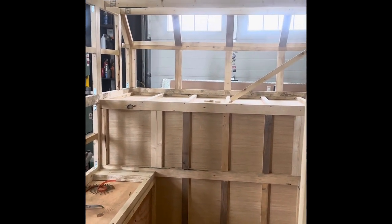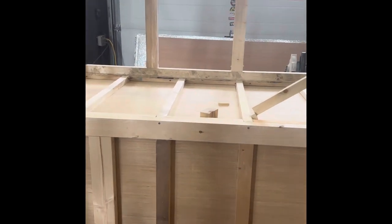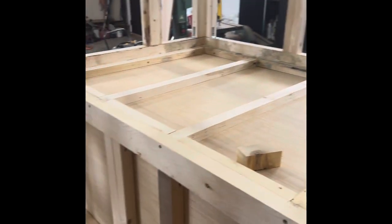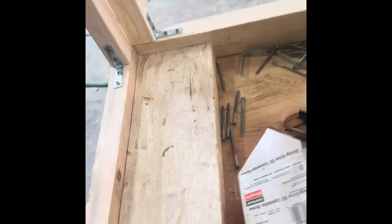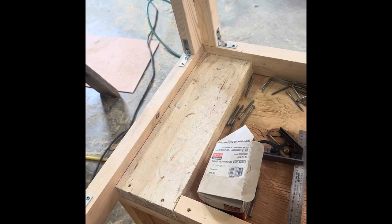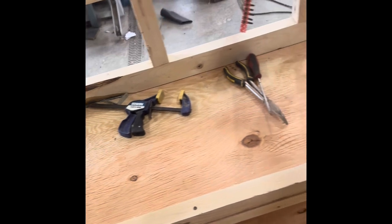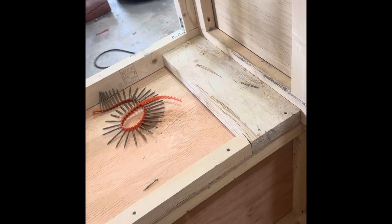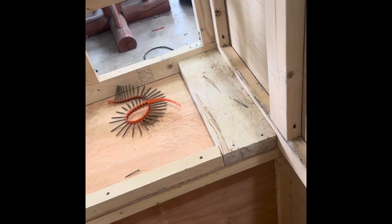The ceiling will also be R10 with two inch insulation. It's just a little single cab-over bed up top, and I'll have a small booth for sitting that will turn into another bed. Right here I put in a couple of pieces of beam material and I'll put some hooks on the bottom side so I can attach it right to the loops in the bed of the truck, instead of having to do belly bars and attach it on the outside. I'll cut a little access hatch on each side so I can hook it up inside the truck box and reach in to the loop.